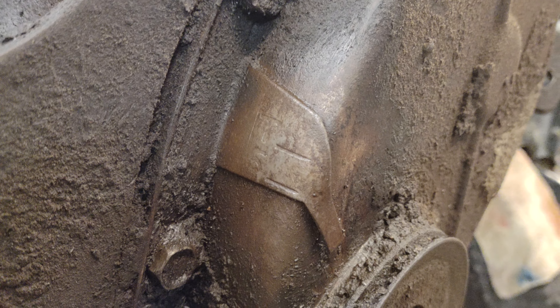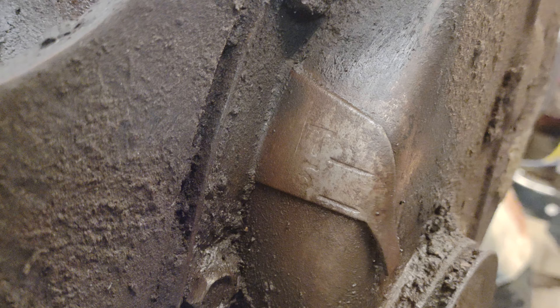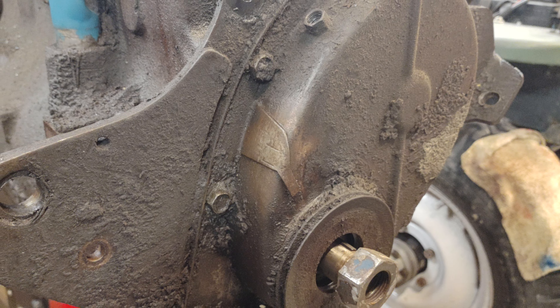You can see this one still has the bracket attached to it. It's really hard to see the numbers on it, but they're in there. The little tab wraps around the front so you can shoot the timing against the gear. A lot of newer motors — and if you're familiar with small block Chevys — will typically have the timing marks over on this side so you can see them a little bit easier. But these little motors, they're over here on this side up against the timing cover.